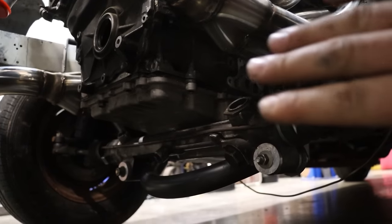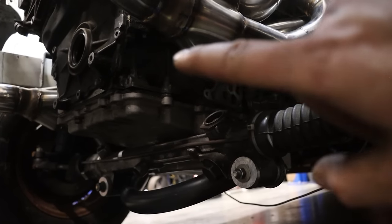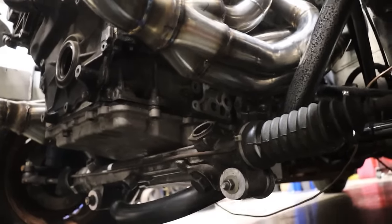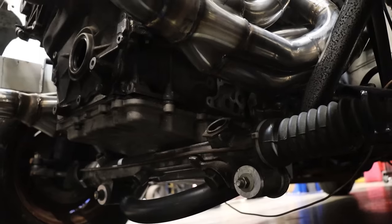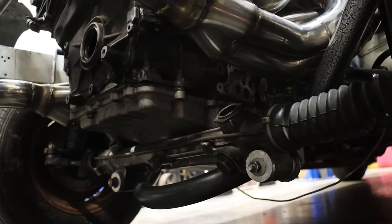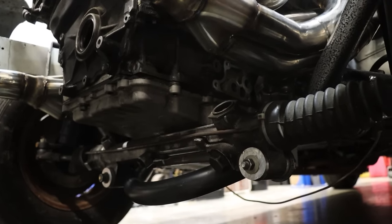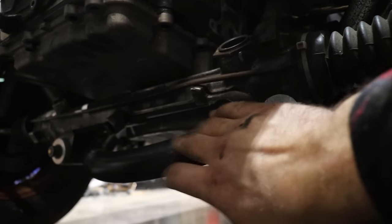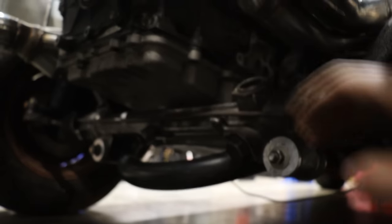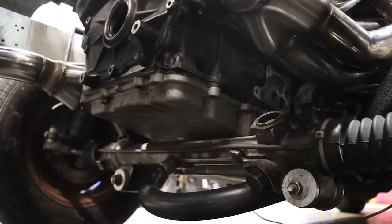The LH2 has a factory rear sump offering, and I bought one off eBay as soon as I found out they were available. This is originally spec'd for a Cadillac XLR and it is a factory eight-quart oil pan, which should do very well in this chassis. To make the oil pan fit, we had to do a little modification to the K-member — we kicked the bottom of it forward a bit — but now the oil sump fits the chassis very nicely. We will also need to add some turbo drains to the oil pan later.